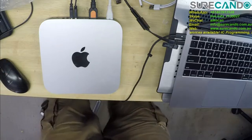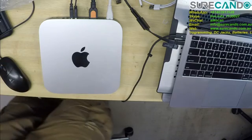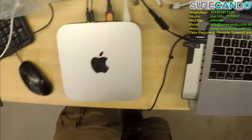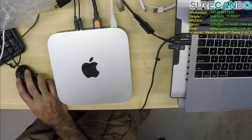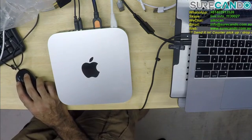I'll try to get file information from the hard drive. SMART status is not supported — that's one of the problems. As you can see, SMART status is not reported, not supported. Even though it's supposed to support it, it's currently not turned on, and hence why we don't get information about the hard drive failing. We're going to see if the client wants to replace the hard drive and we'll replace it with an SSD — that will make a world of difference.